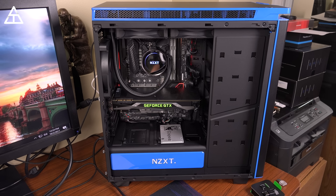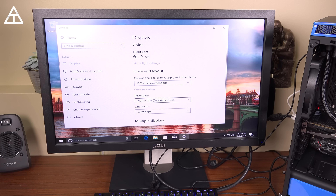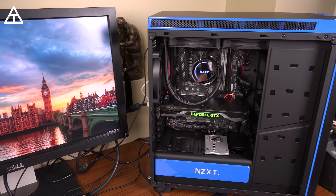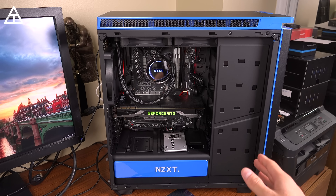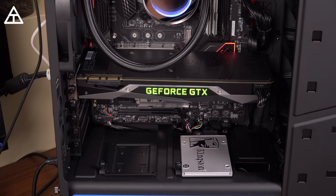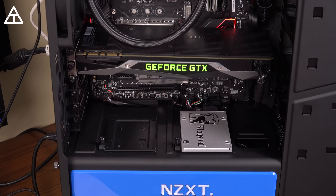We have Windows installed. The build looks great. You'll see the resolution isn't great at first — it's at 1024 by 768. Jump into display settings and change that to 1440, which is what my monitor supports. Keep changes — that was so snappy quick. That looks much, much better, going off that NVIDIA GTX 1070. And there we have it. I'm very excited to say that this build is done. This is my first PC build — more upgrades coming in a future video. I might benchmark it, run some gaming tests, and of course that upgrade video. Drop some comments on games to play and things I can do to customize it. I hope you really enjoyed this video. Thank you very much for watching — be sure to subscribe. Have a good day.